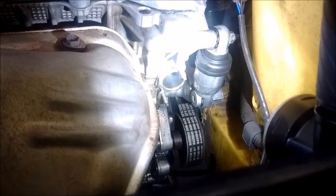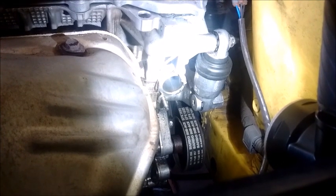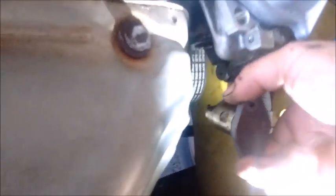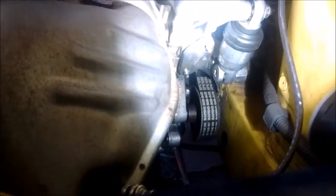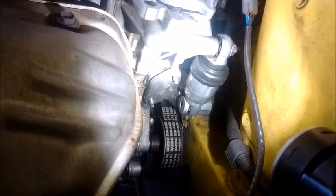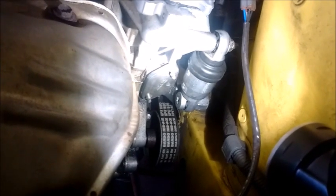Where the tensioner goes is in a cavity in the back of the engine. With the tensioner there's only one way to put it on correctly, so there's no chance of screwing that up — if you try to put it in the wrong way it simply will not go. He went in straight, and all I have to do is put the two 10-millimeter nuts on the back of those studs. After that I'll show you how to release the latch on the tensioner.